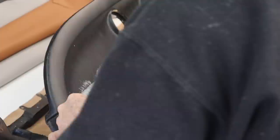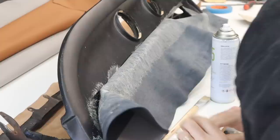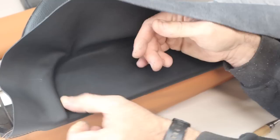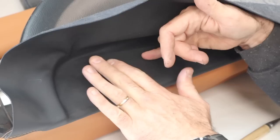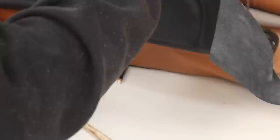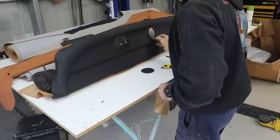In this spot you can see I really stretch the leather on the flat area to give it room when it gets to the transition, spreading the tension over a larger section rather than trying to stretch everything in one tiny area. In this corner I had to really stretch out all of the leather on the flat before getting to the curve, so I had space to let the leather bunch up back in the corner and get a nice transition. I'm working my way backwards and forwards with the handle of a paintbrush.